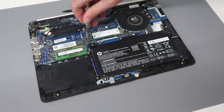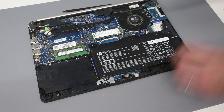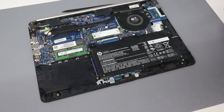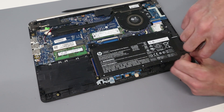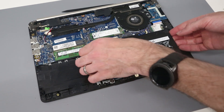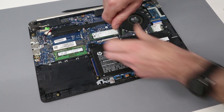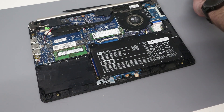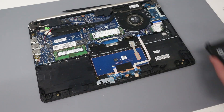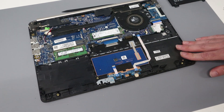Now, once inside, the first thing that we are going to do is remove the battery, which is held in with four screws. This is a fairly standard HT03XL battery, typical in a lot of HP laptops. We are going to lift that out — by removing the battery we are just ensuring — there's one more back screw there, four screws total. So, by removing the battery, we're going to just lift on the front edge and then slot it out at the bottom. By removing that, we're ensuring that the laptop is electrically off.